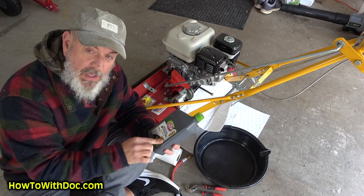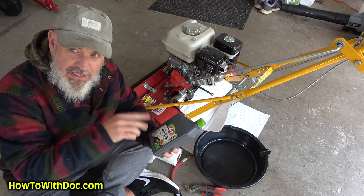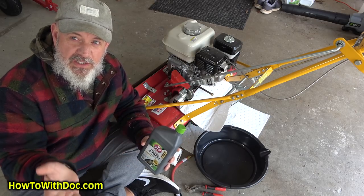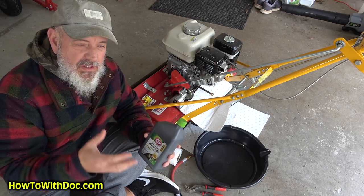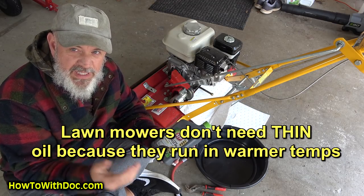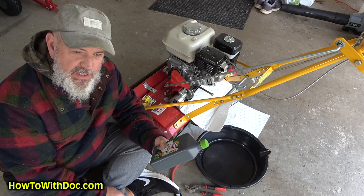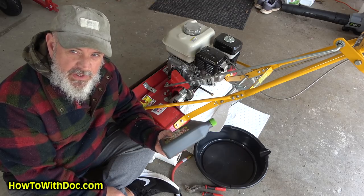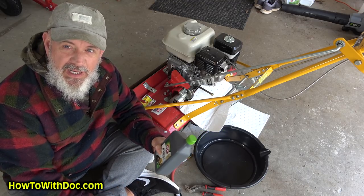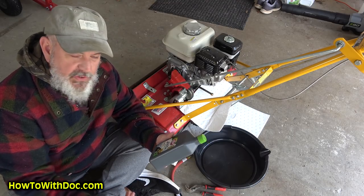If you want to go over there, there's a full explanation from the oil industry explaining these numbers. But basically, unlike a car which has to go through the winter, summer, and all these different months, we know that the lawnmower is going to be used mainly in medium to warm temperatures. So SAE either a 5W30 or a 10W30 is what you want to use in them. People ask, should I use petroleum? Should I use synthetic? It doesn't really matter. Nowadays, all your manufacturers say as long as it meets the specs — which these all do — you can use whatever you want.